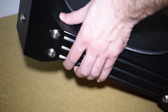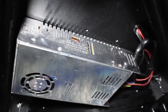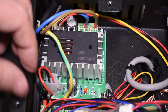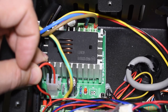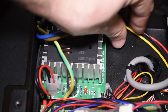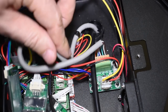Underneath the printer, we can find the power supply. It's a 24V and 16.6A output. The input voltage selector is on its side. Back to the top side, we can see a DC-DC converter and a 12V output for the Gen board. The converter has another output on the other side with 12V and 24V output. From there, it connects to a smaller board. The heat pad is powered by 24V and controlled by the Gen board internal MOSFET.